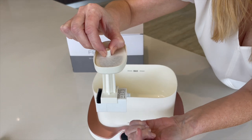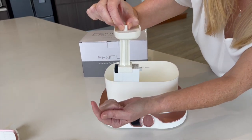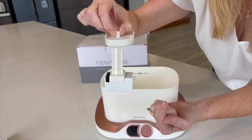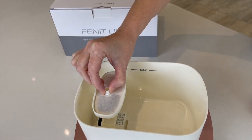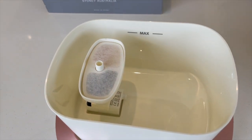There is a special seat molded into the base of the water tank to hold the filter pump. Please make sure that the black density sponge is facing towards the side wall of the tank and the white nub on the pump faces towards the main part of the tank. The pump should sit flush down into the base of the tank.